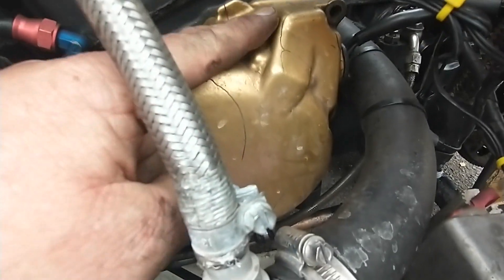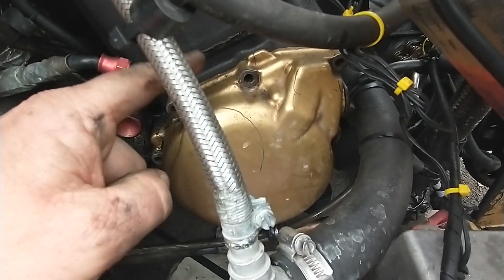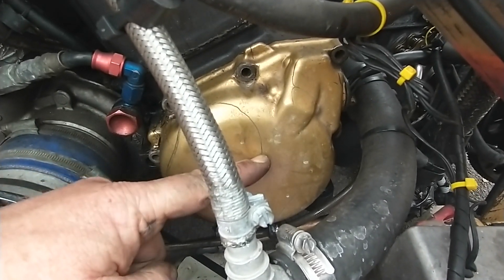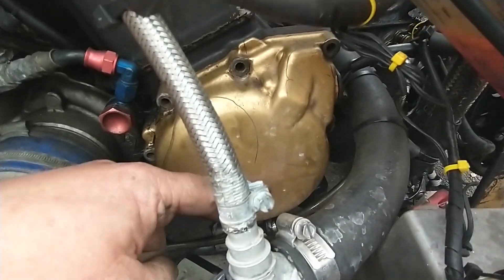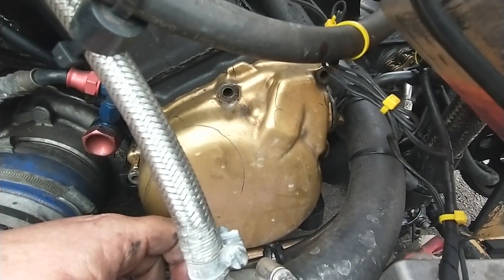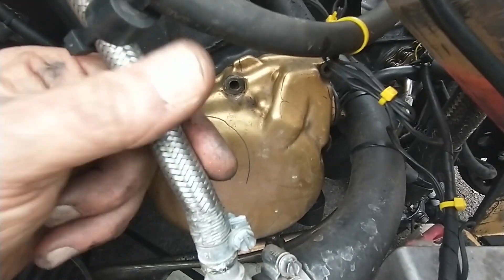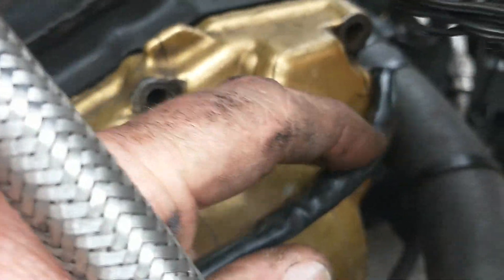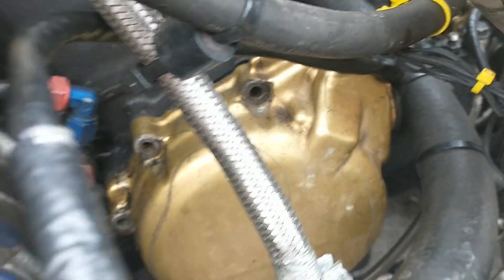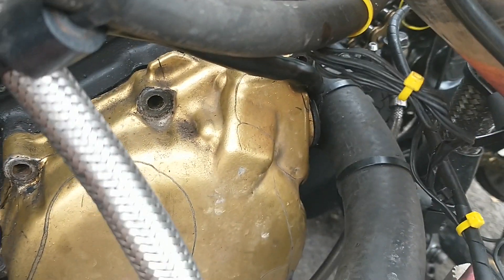Very hard — I've got all the bolts off to change it. A little word of warning, because it's bitten me before. Remember there's a sodding great magnet on the end of the crank, which is trying to pull that in all the time. So keep your fingers well clear when you're taking this off, because it has a tendency — if your hands are oily — you might have your fingers around there and the magnets suddenly sort of pull it in and it slams in. You may realise this is me talking from experience. Make sure that you've detached the wiring loom part so you don't get it part way out and then it pulls and catches your fingers.